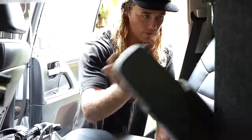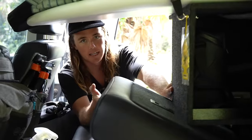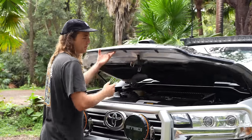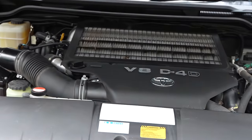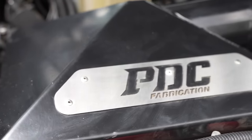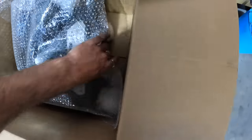We still retain this as a four-seater — the custom box can be removed at any time to have the fifth seat, but for now four seats is perfect for us. Let's talk performance. Under the bonnet it's pretty stock but we have done a few things. This is a 4.5-litre twin-turbo V8. One of the main issues with these cars is dusting of the engines, so the first thing we did was put a Patrol Doctor air box on. This car is out of warranty, so we could do that — Toyota won't warrant it if you put a new air box in while under new car warranty. The Patrol Doctor air box uses bolts to clamp down on the factory Toyota filter.